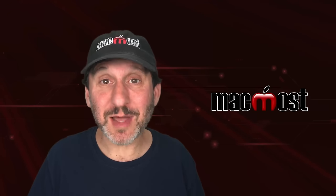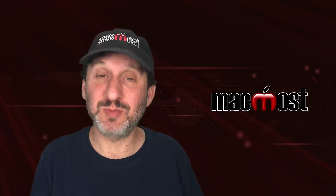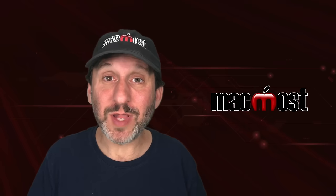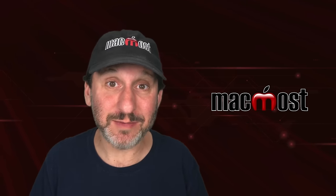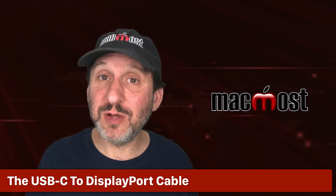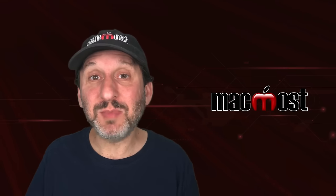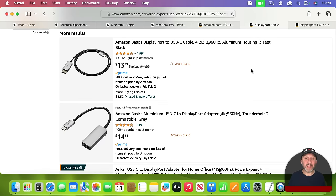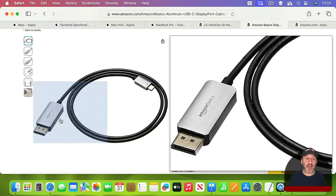Keep in mind that a lot of times your display already comes with the right cable, so you may already have a USB-C to DisplayPort cable in the box. But cheaper displays may come with no cable at all or only an HDMI cable. To connect from your Mac to a screen using DisplayPort, you simply need a cable with USB-C on one end and DisplayPort on the other. If we look on Amazon, here's an Amazon Basics one for $13 — USB-C on the source end and DisplayPort on the other end to go into the back of the screen.